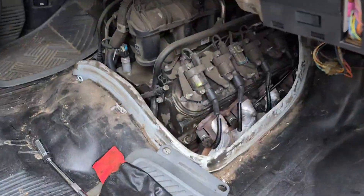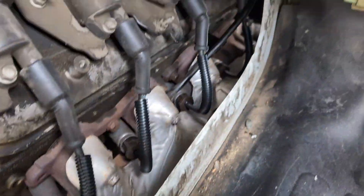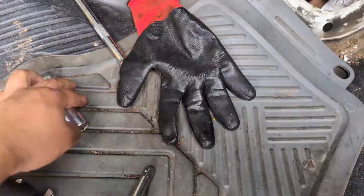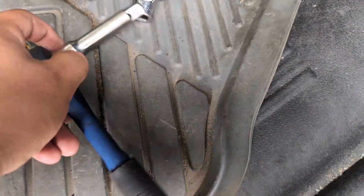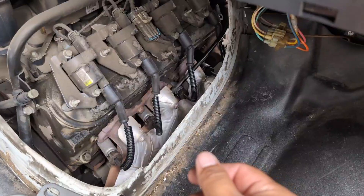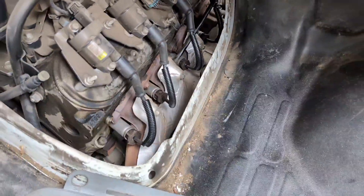I'll work on the other side — hopefully it's a little easier. You could probably also get the spark plugs by jacking up the car, taking the wheel off, and accessing through the side. For the back ones I used this spark plug socket with a wobble and a small extension — probably about a two to three inch. Once you're putting the spark plugs in, thread them in by hand — you don't want to strip anything, because the last thing you want is to strip a spark plug in the engine.